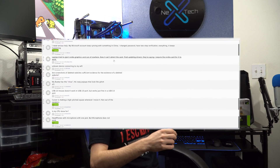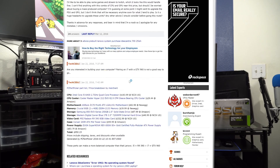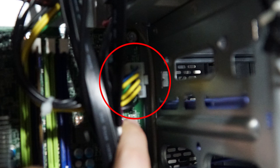This computer was originally intended by Lenovo to be upgradeable, but if you look at tons of forums on this thing, it's not that upgradable because it has a 250 watt power supply and you can't replace it easily. They use a 10-pin versus a 24-pin connector on the motherboard, and it's proprietary on top of that — the wiring is all different, so you can't just splice them together very easily.